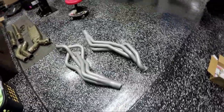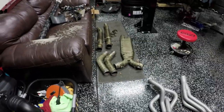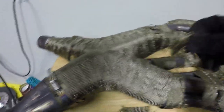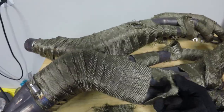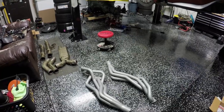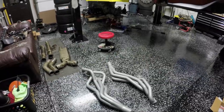If you've watched any of my previous videos, you'll know that before I had them wrapped, similar to the exhaust pieces over here. While that worked great for the parts underneath the main body of the car, it didn't work for the headers. Once this stuff gets really hot it gets very brittle, which is fine — except when your headers rub on anything. The headers were rubbing a lot, not because clearances were super tight, but because the motor was just flexing a lot — I had more than a quarter inch of clearance in the tightest spots.